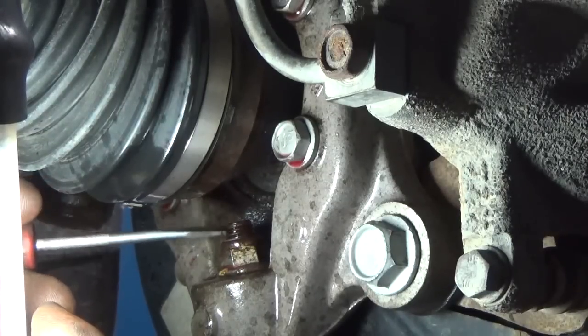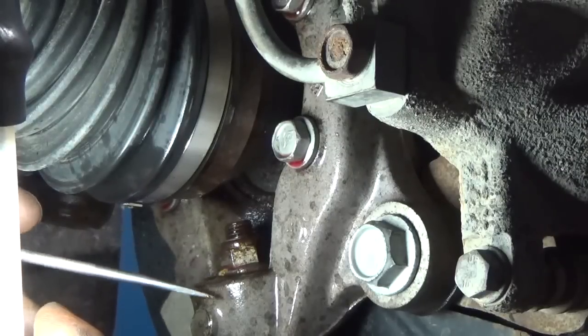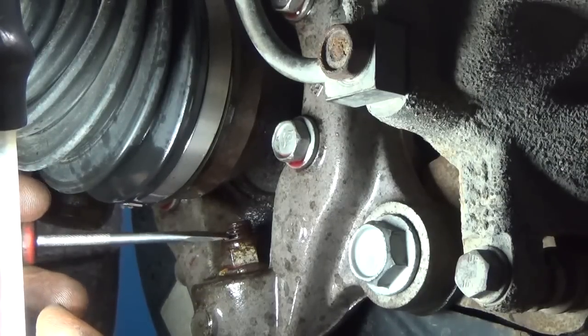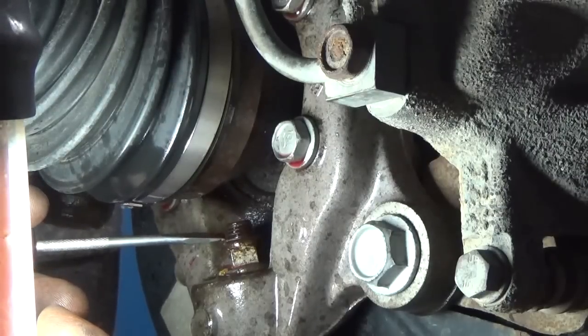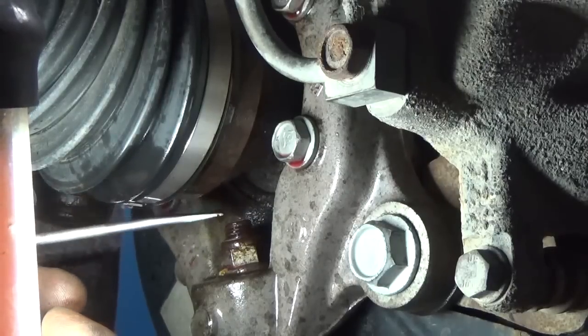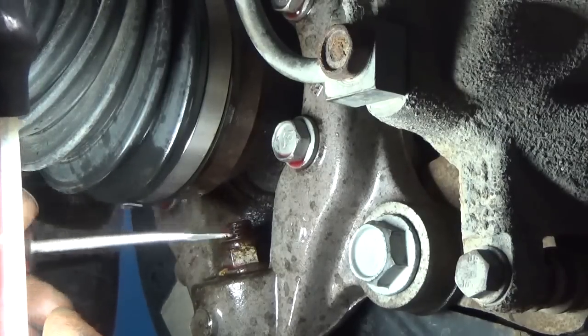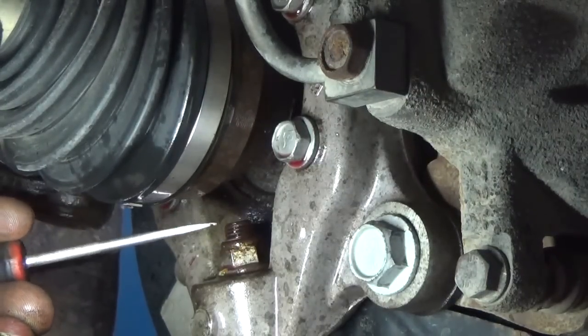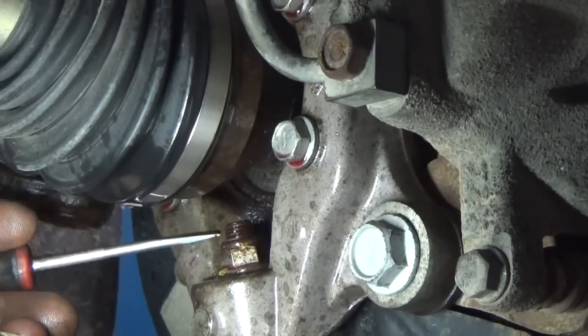Once you bust this joint loose, the stud out of the steering knuckle, the friction of the lock nut is going to overcome. You've got nothing to hang on to at that point, is what I'm saying. If this was just a nut we could crack loose and spin off by hand and pop this loose, then we'd be good to go. I hope that makes sense, but that's my reasoning behind getting enough room to get this all the way up and out.